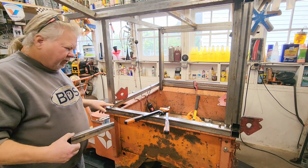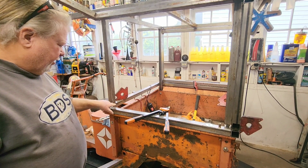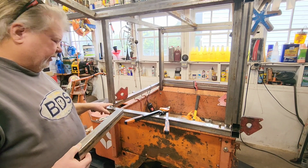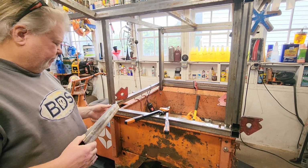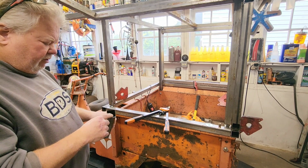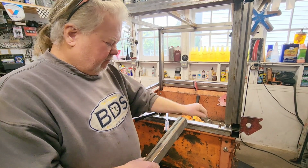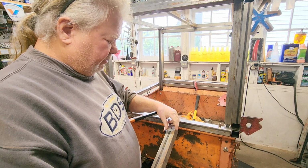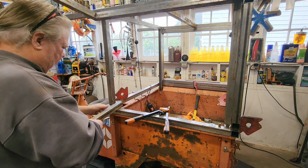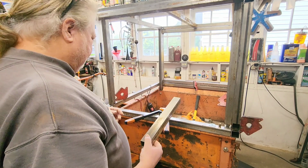So what we're going to do is put rivet nuts in, or nut certs, if you want to call them that. I've drilled a 9/16 hole in both sides for a 3/8 nut cert. Then we're going to eventually drill this out. We're going to put a little backing in here or some support, probably weld some washers on. Give it a little support, so that we can put a long bolt in with a spacer here. Let that pivot. So that's what we're going to do.